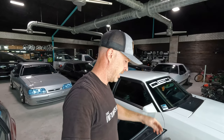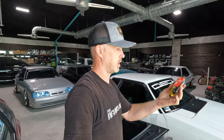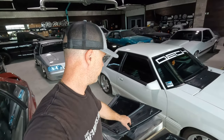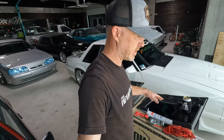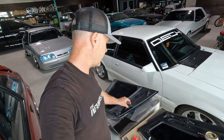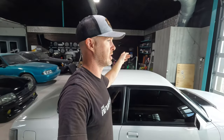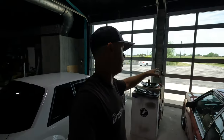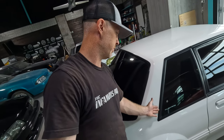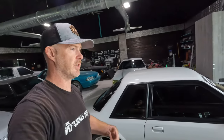I took some Loctite premium three-times-stronger construction adhesive — not epoxy, construction adhesive — and I reinforced all the stud areas on the passenger side window, then did the same on the driver's side. I gooped some more material around the area that encases the stud mounts. I got them installed, the car was parked out front on a hot sunny day, and I came out to find that part of the driver's side window was sticking out from the body. It had popped two studs.